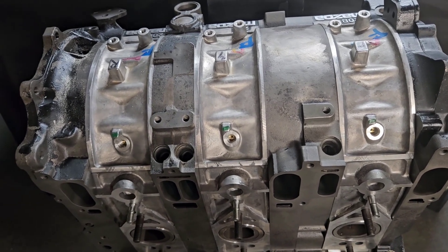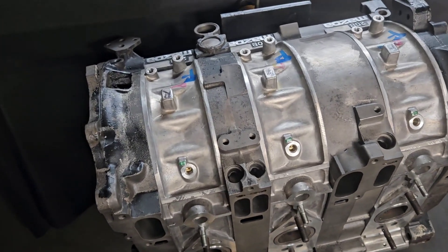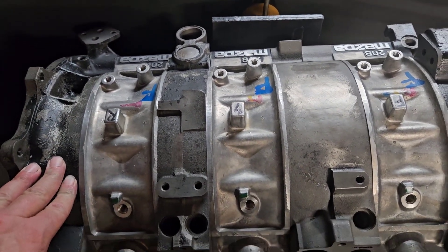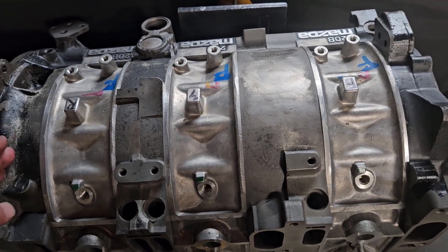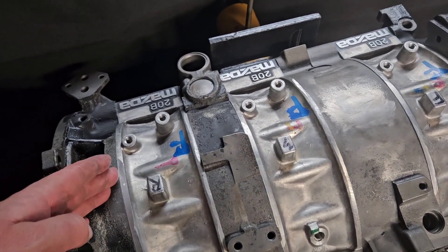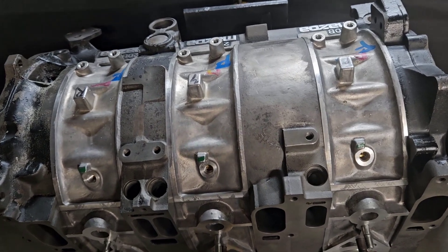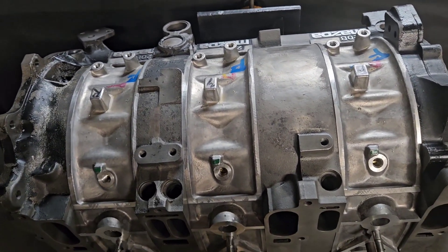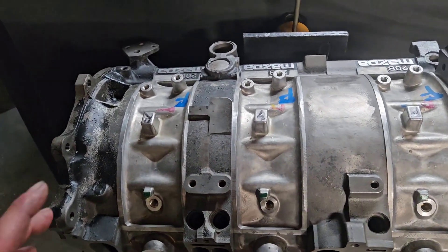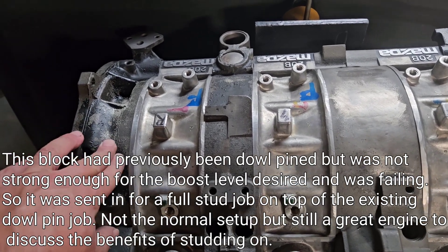As the rotary evolution has occurred, there have been a couple different variations of strengthening blocks. All of them work — I'm not saying different styles don't work. But what we found was in the end, full studding of the block lends some of the best strength and helps with reliability under high loads, high boost, high RPM, race conditions, and extreme conditions. But it's also very repeatable. For a long time, dowel pinning has been done to rotary engines — in some cases using factory dowel pins or modified hardened steel dowel pins inserted with tension bolts running through them. It does work, but there were limitations. In some cases, the castings from the factory didn't have a lot of surface material to allow for the machine work for dowel pinning.